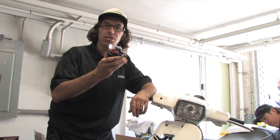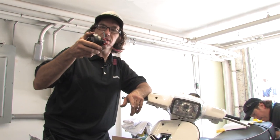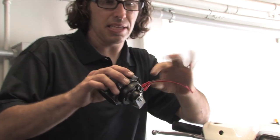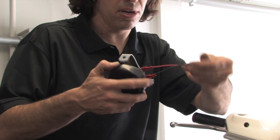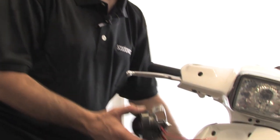I went ahead and modified the horn bracket to fit on this S — pretty much the same arrangement if you're installing on an LX. It's bent back and forward a little bit, and I've also added two little extension leads — basically two quarter-inch quick connects, which you can get at any auto parts or hardware store, and two little pieces of 18-gauge wire to extend the reach.